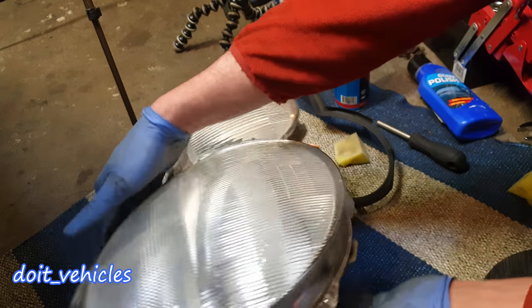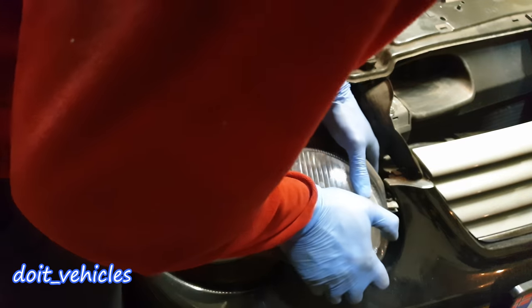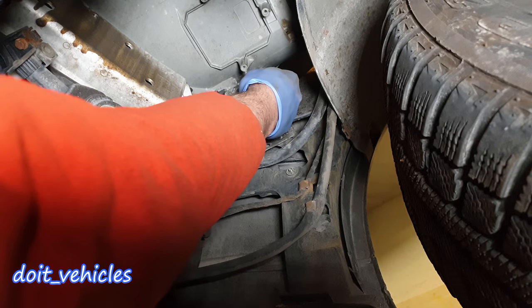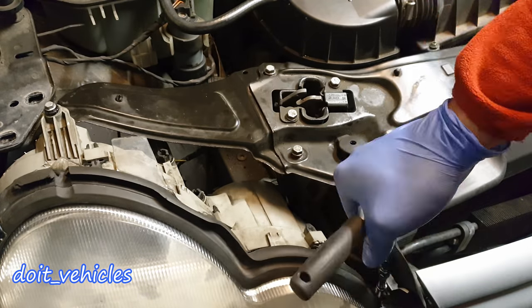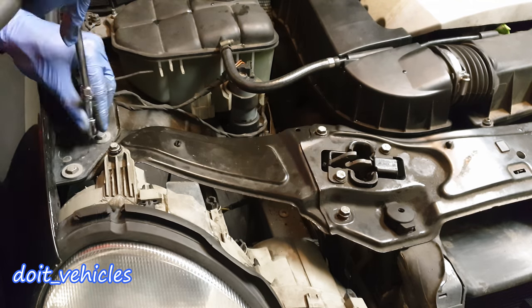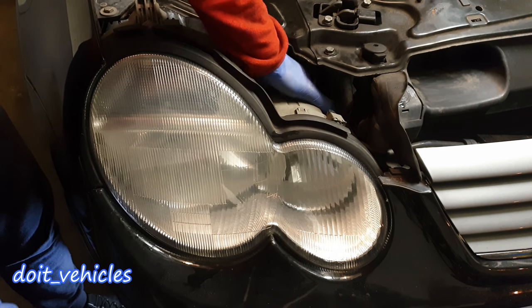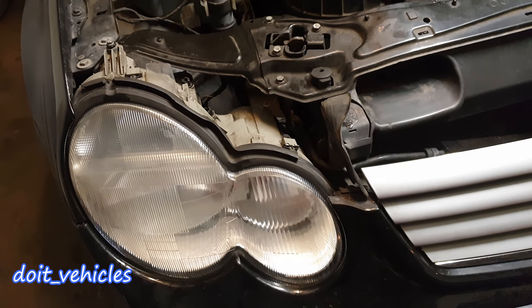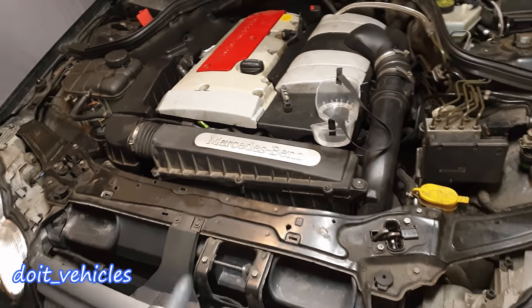Now I am going to place back this rubber gasket — it just goes one way. Now the unit is ready to be installed. The installation is the reverse process, so I am going to place back the headlight. You just have to place this metal nut back in there, place the bolts, and that will secure the headlight in position. Now the headlight is fixed — it doesn't move even when I press a lot on it. That's how it looks right now — it's not perfect like new, but still it's much better than before. Let me know what you think in the comments below, and until next time, drive safe and I will see you soon.